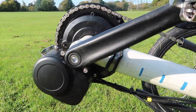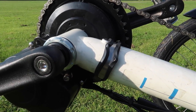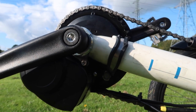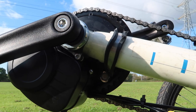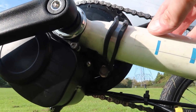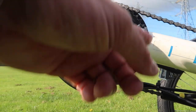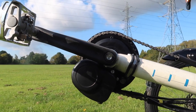The Tongsheng kit comes with everything you need for fitting to the trike, except for the pedals and a P-clip that I needed to buy to fit around the boom. There's a bolt under here that would normally have a bracket attached as part of the kit — that bracket attaches the motor onto the down tube on an upright bike. On a trike that doesn't fit because there's no down tube, but there is a boom. So the P-clip attaches through the bolt hole and around the boom, stopping the motor from pivoting and holding it nice and steady. Apart from the P-clip and the pedals, everything else is in the kit.